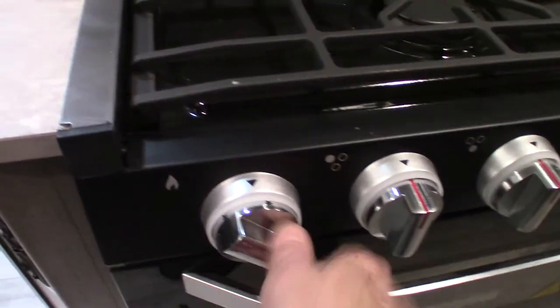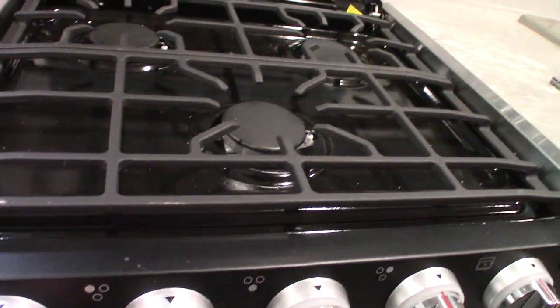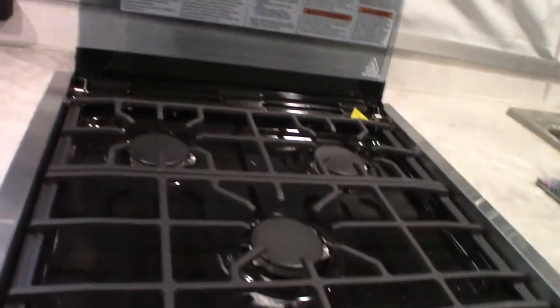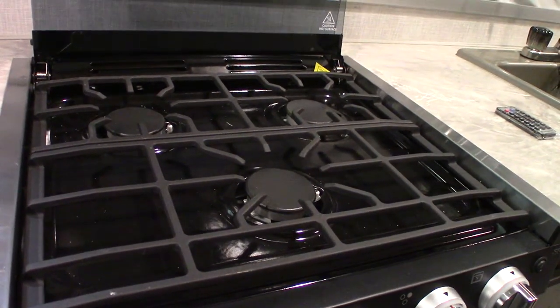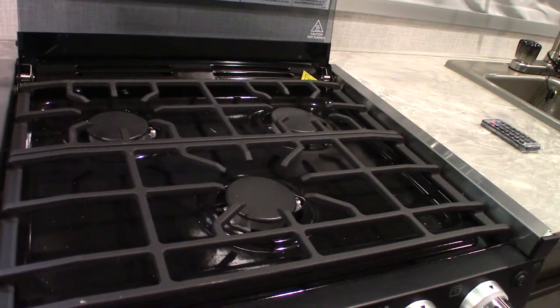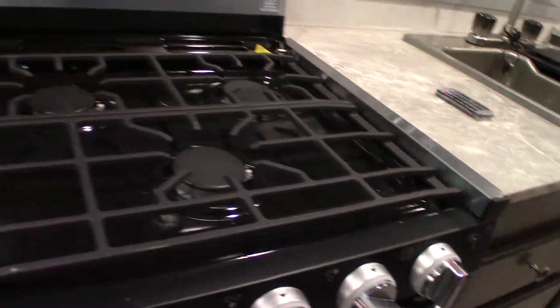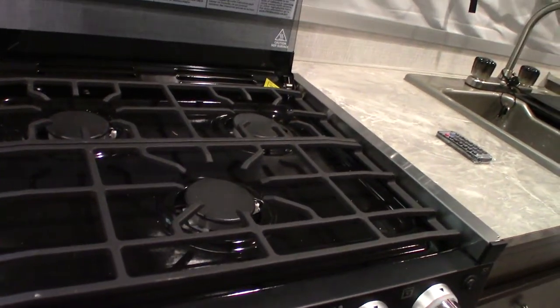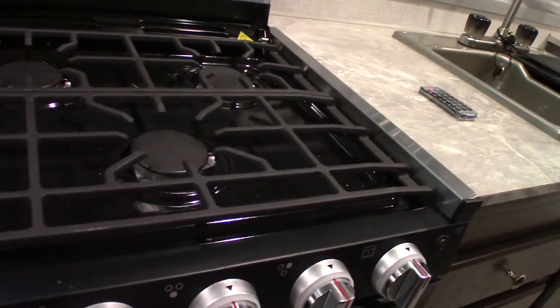With the range — this is the sparker, you turn it clockwise — three burners, three knobs, and then the oven. We've changed over the tank so I'm going to spark it to get the air out of the lines and replace it with gas, because there's nothing in there right now from working on it. If that doesn't work, I can go out there and check if the tanks are turned off, which is probably the case.